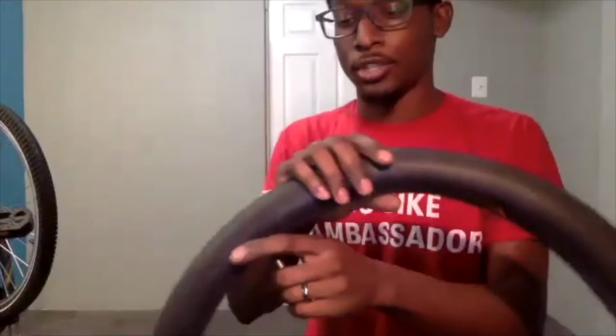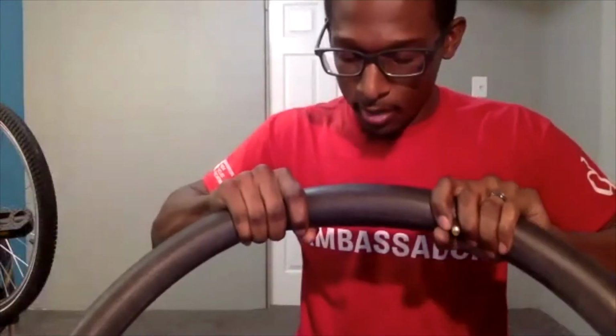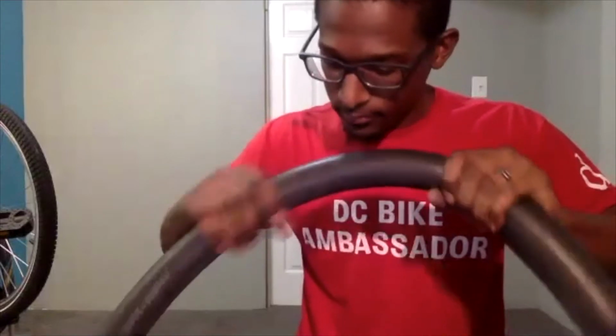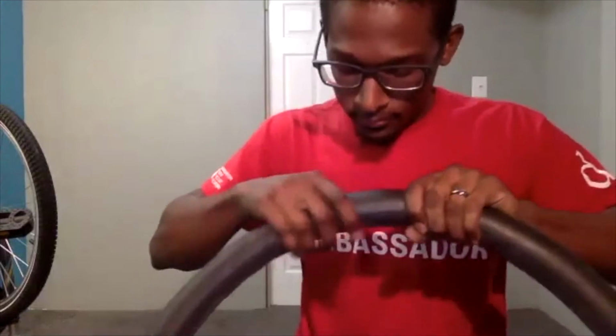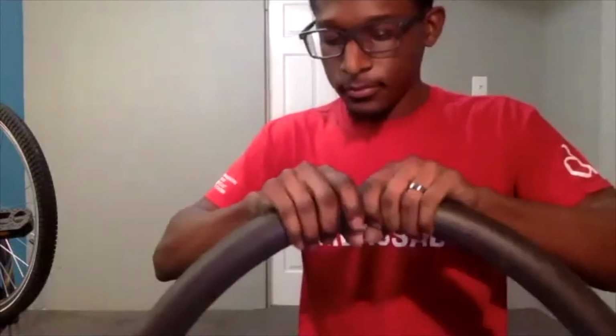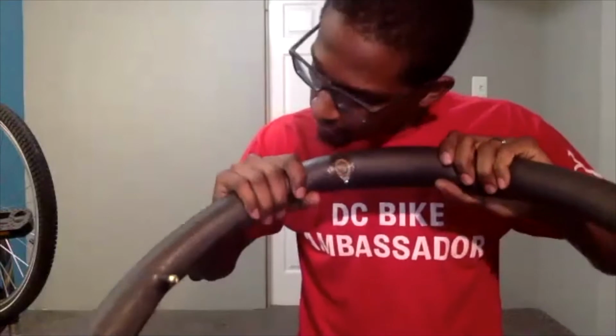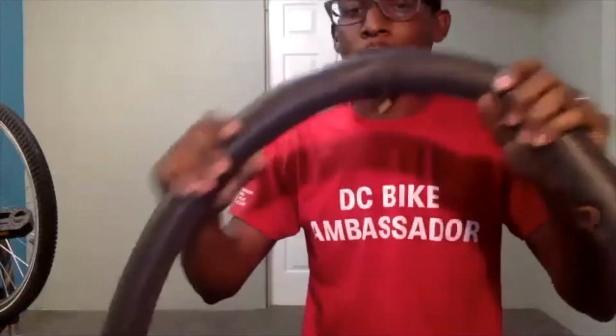But what I will do one more time is work section by section around, because there could be a case where you have more than one puncture. So again, starting at my valve stem and working my way around one more time just to confirm that there are no other punctures. And I will get to your second question in just a second. Thanks for putting that there. So again, it is holding air from when I just pumped it up. So I know that I can just work my way around. I don't hear any air escaping, and after doing a full lap, I can confirm that no air is escaping from the inner tube.